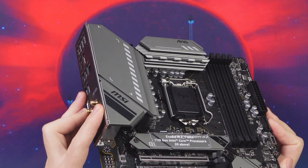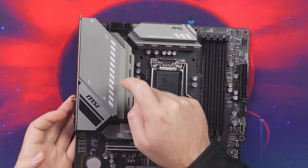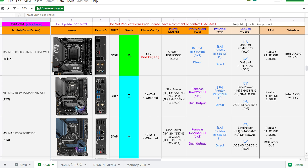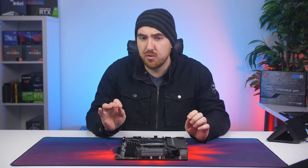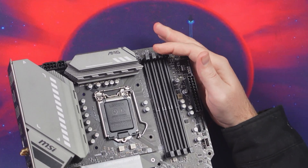The VRM setup might not be a big deal since you won't be overclocking your CPU, but you do have a very nice heat spreader all around, which extends all the way over the I/O cover — a nice touch I haven't seen too often. Thermals shouldn't be a problem. If you want more details on the VRM setup, check the link in the description for a spreadsheet. It is a 12+2 phase design, which is pretty decent — not the best, but definitely good enough for everything you'll be doing.